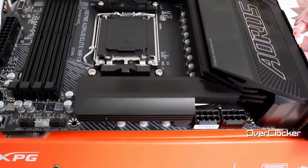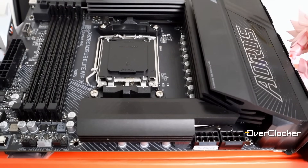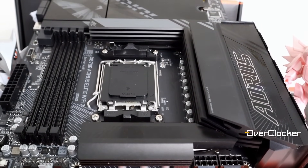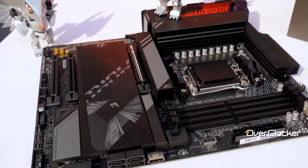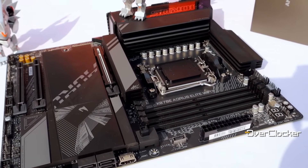This board uses a 6-layer mid-loss PCB featuring a 16+2+2 parallel VRM system, which should be using 60A power stages. So clearly this is a cost-effective design. However, that doesn't mean it's not a capable board — it should be able to handle a 600W power draw or higher from the CPUs that work on the AM5 platform.